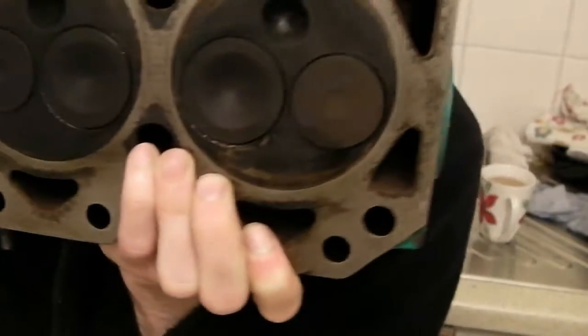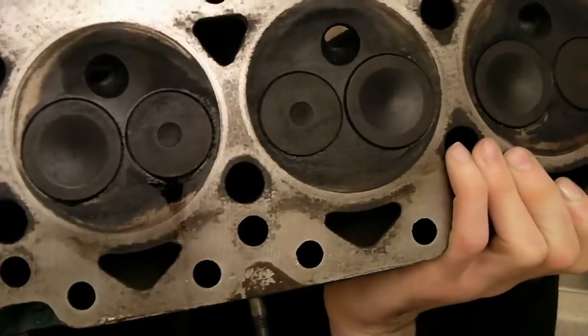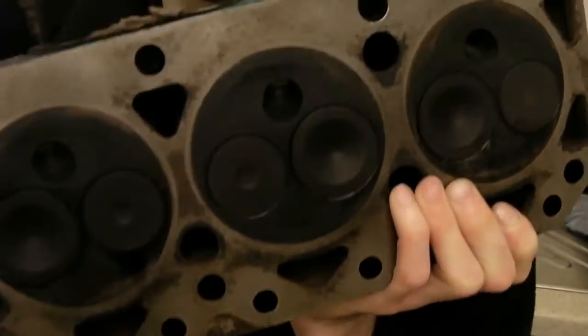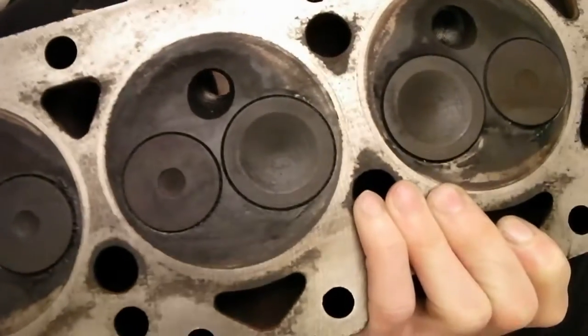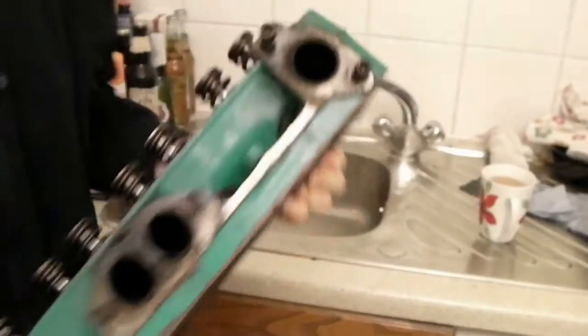This one had six bar and it's clearly leaking from the exhaust valve. And again, this one too has definitely got a leak. I'm pretty sure this one probably leaks as well, but for some reason it's not showing right now — we'll try that one again. That's disappointing.